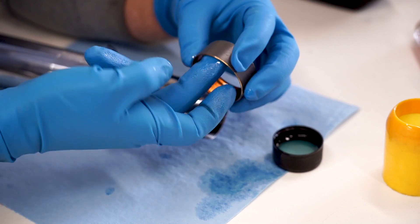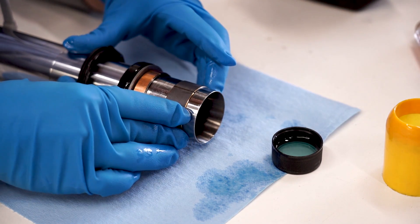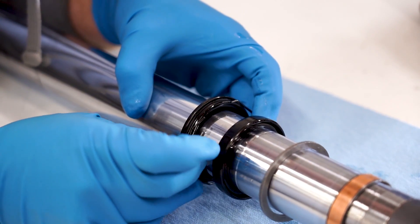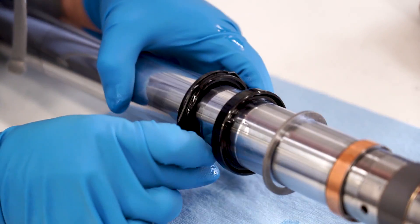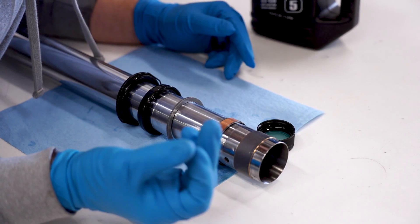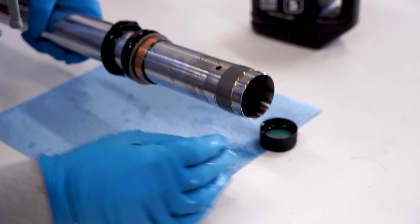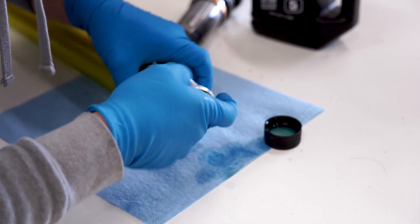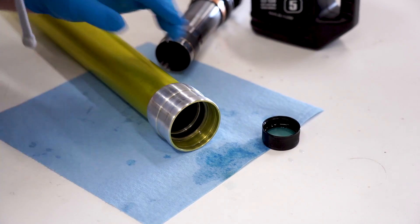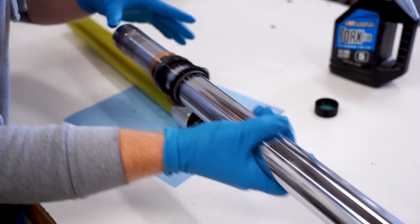This one's going to snap into this groove here. As you're moving these parts around and assembling things, the snap ring will just flop around and might scuff up the tube a little bit. So what I like to do is pop it onto the dust seal just so that way it stays in place. One thing I didn't mention with these bushings - they can go either direction. You'll notice the edge is the same on both, so it doesn't really matter. Once we get a little bit of oil on these bushings and seals, we are ready for the upper tube. You want some oil inside of here as well. This yellow along with the brushed lug is just going to look insane.